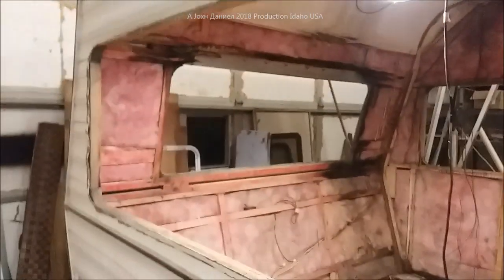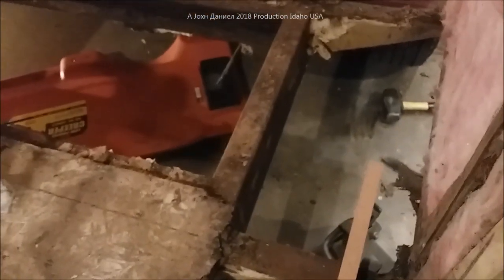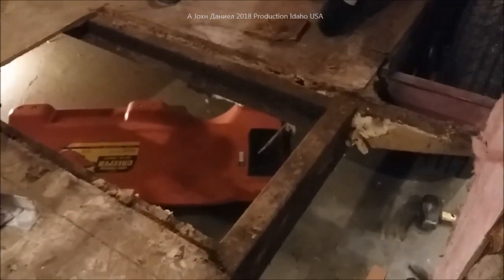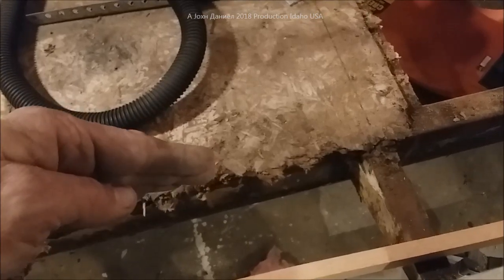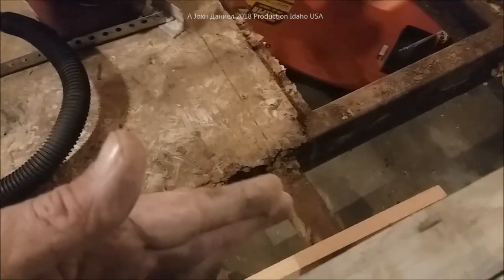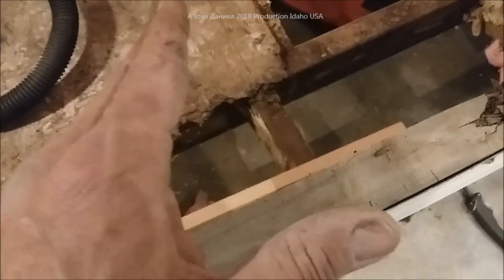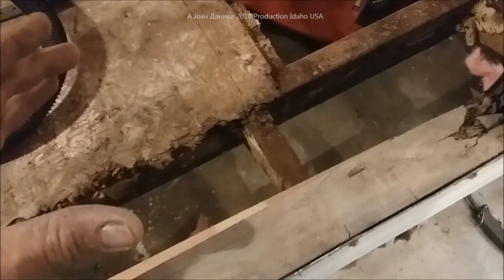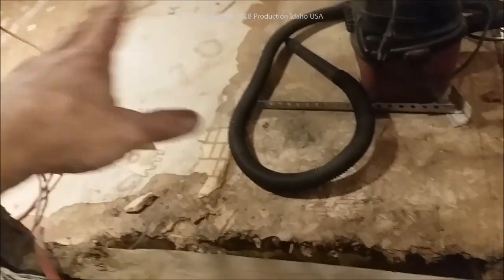This is an old Holiday Rambler, gutted and doing some repairs. Right here was where the bathroom section of the trailer was and you can see it's got some pretty good damage. We doubled up underneath — the steel is in good shape still — but we're looking to add outriggers. That's actually still good wood. We're going to show you how to add an outrigger to a trailer so we don't have any more problems of wall shear, which is when the wall starts to sag down. At 34 inches that's too much span, so we want to be able to roll a rolling toolbox in here. With three-quarter plywood and half-inch on top we're going to be really stout, and the rest of this OSB is in good shape.